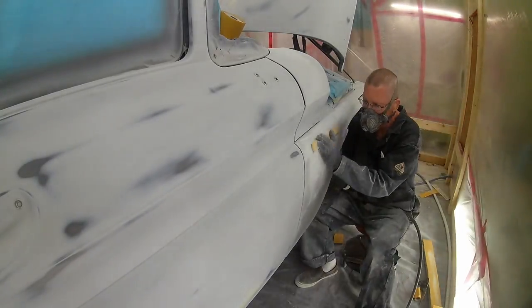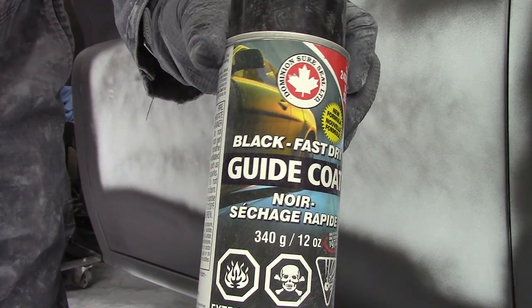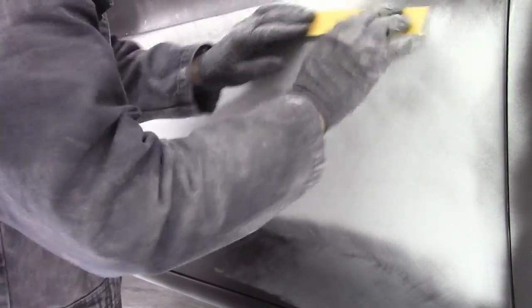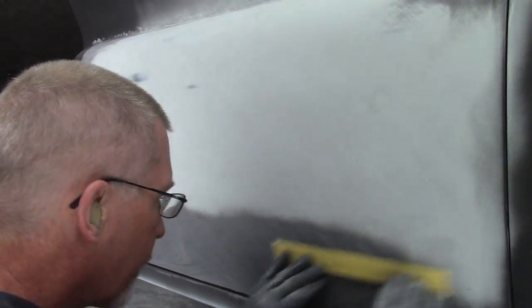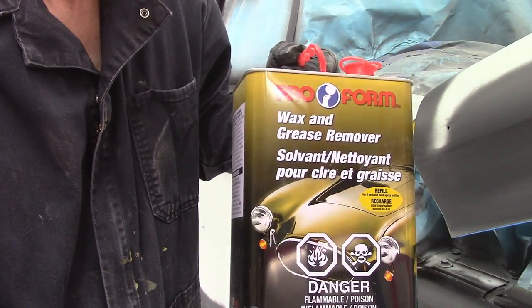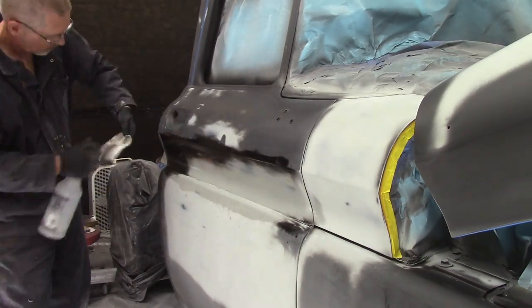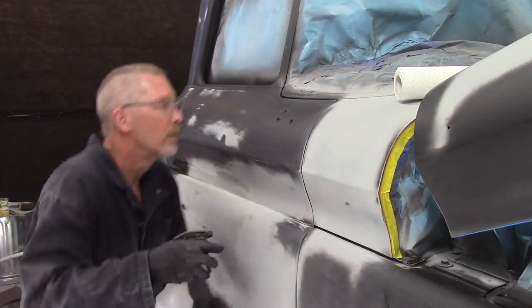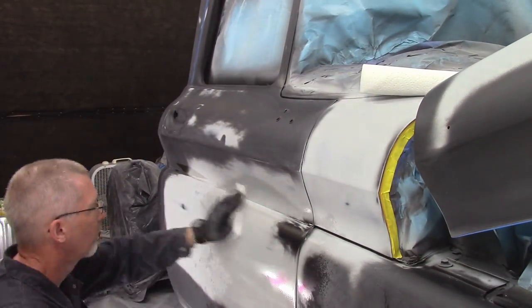And then back to the paint stick for smaller areas. On the doors, because I was worried about it looking yucky, I did put down some guide coat — you just mist it on and let it dry, and then it kind of comes off. You can get this as a powder as well, but I do love my aerosols. And you'll see I put down a little bit of epoxy — I think I went down to metal in a couple spots or I added some filler. Then once you think you've kind of had enough of sanding, you're going to wipe the whole thing down with wax and grease remover. I use paper towel, fold it in half, and that gives me four surfaces of clean paper towel, and I wipe it until the paper towel comes out clean. Then I move on to the next area.